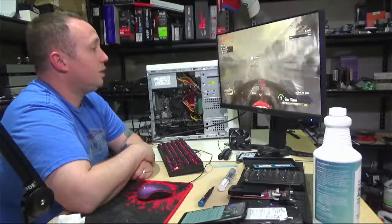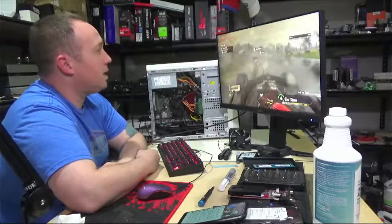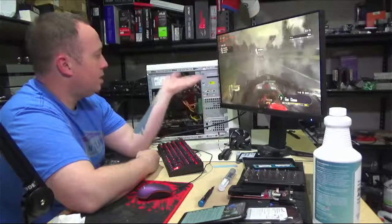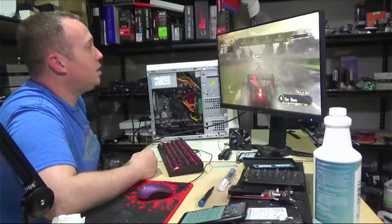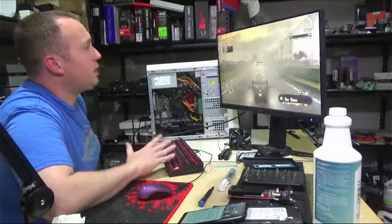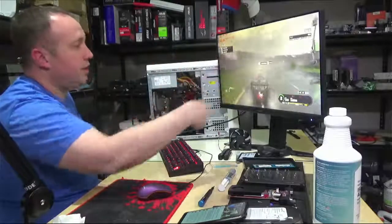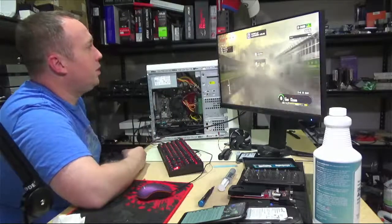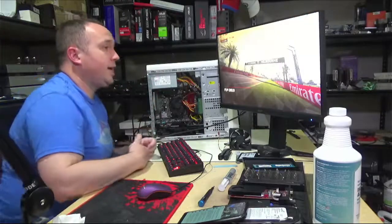That looks awesome. It's a really smooth line. I mean, we got some jitter in here, but it's not like crazy spikes, and this is like worst case scenario, right? For this setup, it's heavy rain, so it's stressing the CPU and the GPU. We got 99% CPU utilization through that corner there, and 99% GPU utilization. So the CPU is mostly hanging out at about 60 to 70. I guess it depends on, since we're doing the cycling camera angles, some of the camera angles work that CPU way harder. Yeah, this one right here seems to work the CPU a lot harder, but it's still keeping this GPU at full chat, 98, 99% utilization.